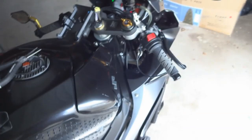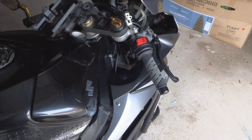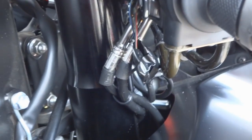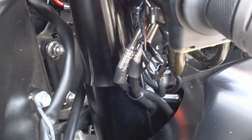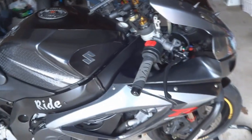That's pretty much almost done. I was able to get the Brembo master cylinder brake light switch to go into the OEM bracket. I used electrical tape to make sure the connections stay together — not the best idea, but I didn't feel like soldering it in case I had to cut it or go back to stock. You can obviously do whatever you choose. My way is not the best way, but it's the way I did it. Brembo master cylinder install: done.